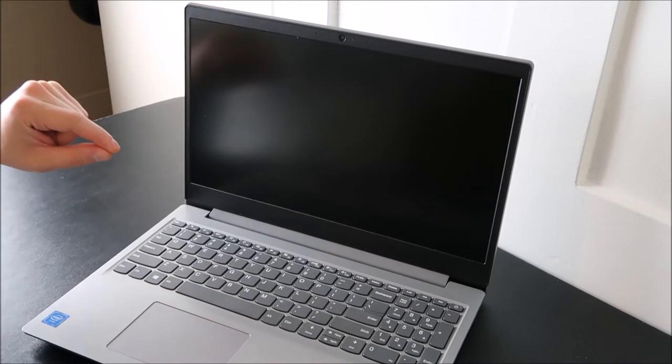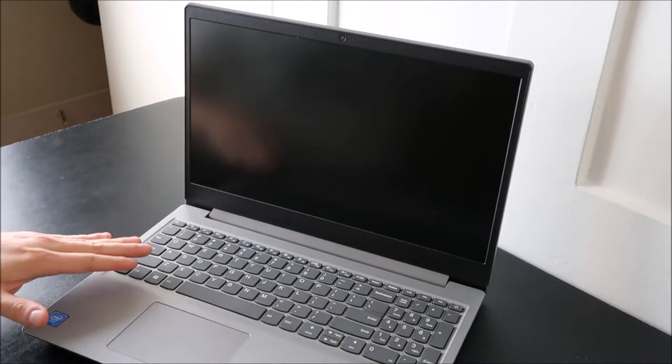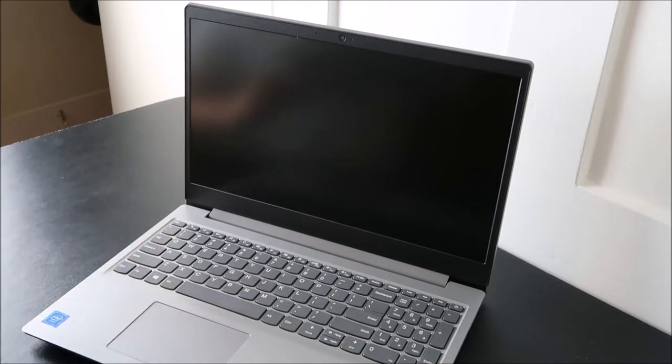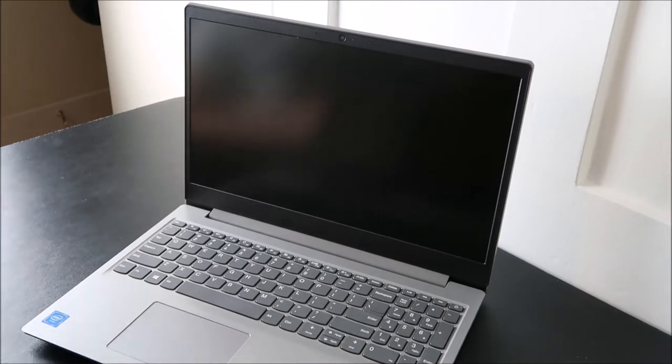To answer the question why we're not swapping out the entire keyboard — it's because on French inset keyboards, to replace the keyboard basically means breaking your palm rest. The new keyboard will never be in there very securely. That's why I prefer to replace keys if at all possible instead of replacing the entire keyboard.